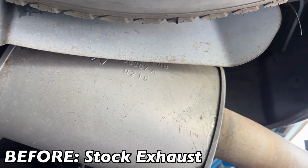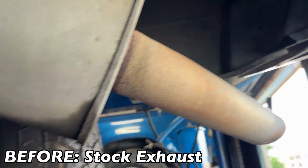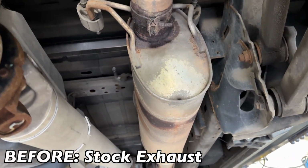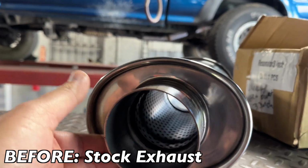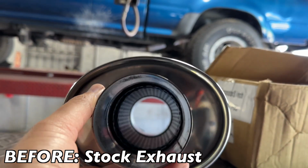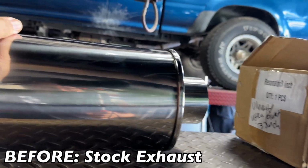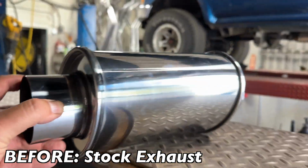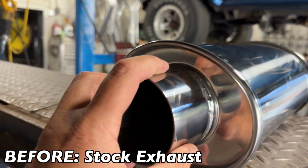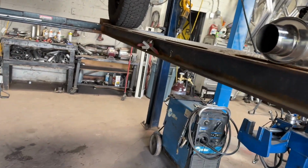So we're gonna delete that resonator, put a 5-inch tip there, and a Vibrant Ultra Quiet right there in its place. There's the Vibrant right here. 3-inch in, 3-inch out, straight through design. If you guys wonder what it looks like, there it is. There'll be a part number in the description for it if you guys want to purchase one. Stay tuned, guys. We're gonna let you guys see it after.